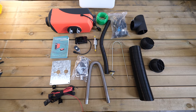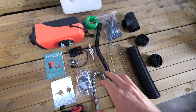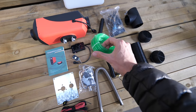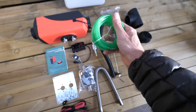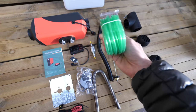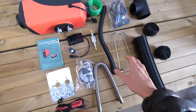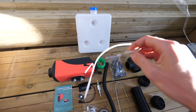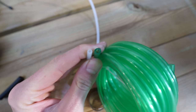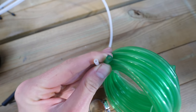You can get these kits for under 100 quid — down to about 89 to 90 pounds. The issue is you need to check what comes in the kit. The kits that come with this really squishy, flexible fuel line aren't great — this isn't a very good fuel line to use. The fuel line you really want is this smaller, hard nylon one. As you can see, the hard nylon is actually much smaller than the green tube that came with the kit, but the hard nylon just works a lot better.